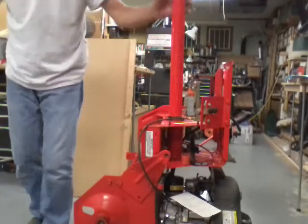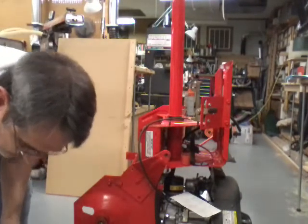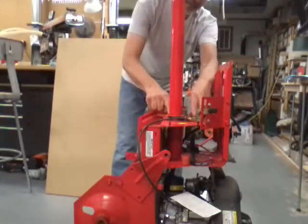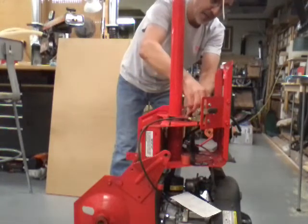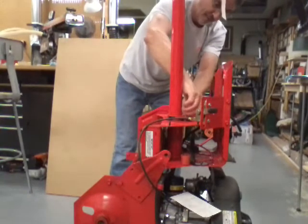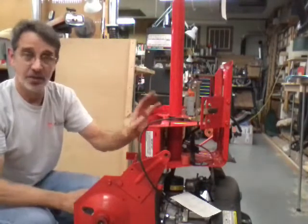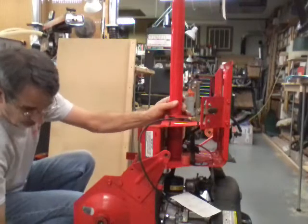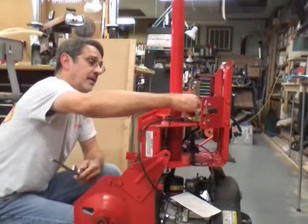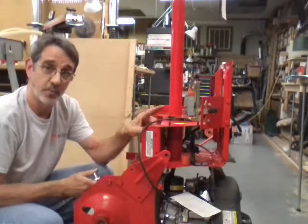Well, it's starting to look like something. In this box of parts there's a plate that goes up here and captures inside this clamp — it keeps the tube in the proper adjustment for the belt. I took it apart this way instead of taking the clamp off the tube, because once you loosen those clamps and try to slide them, they're going to scratch the paint terribly. This way I didn't have to disturb the paint or change the belt setting for the mower deck — this is how you adjust the belt tension.